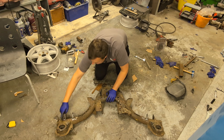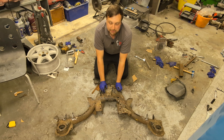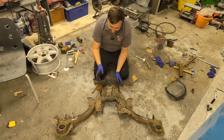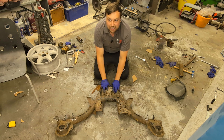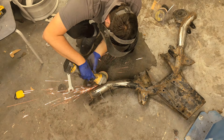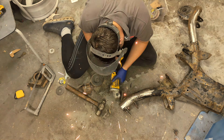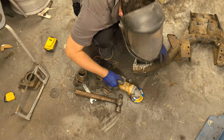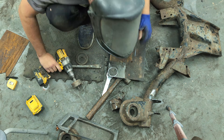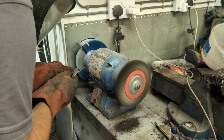What I'm going to do is cut the ends off here and here, and also cut these mounts off, leaving a little bit of material as a reference point since I'm going to make new rubber-mounted brackets — just something a bit smaller, as I think the originals are overkill. The subframe must be at least 3 or 4mm thick, and in the time-lapse it looks easy, but it took ages and I went through loads of cutting discs and grinding discs. In the end I decided to cut off all the original mounts and make completely new ones. I then use a hole saw to cut a 2mm steel disc to plug the open end, dress it on the bench grinder, and weld it in with the MIG welder.